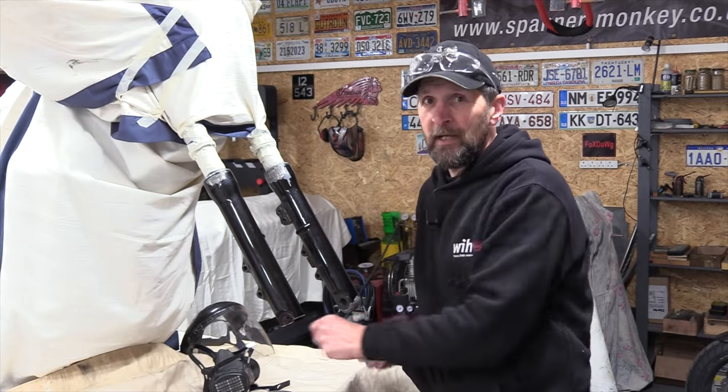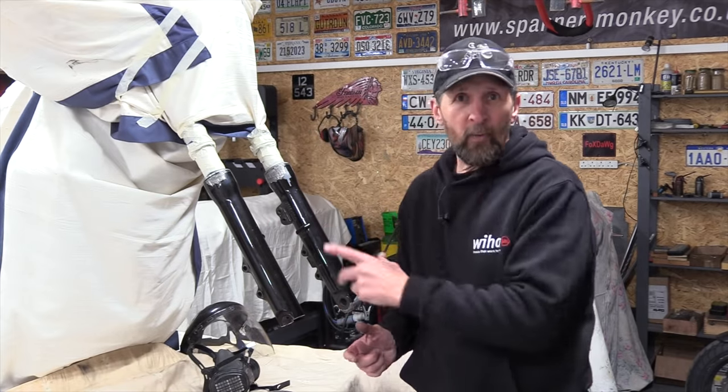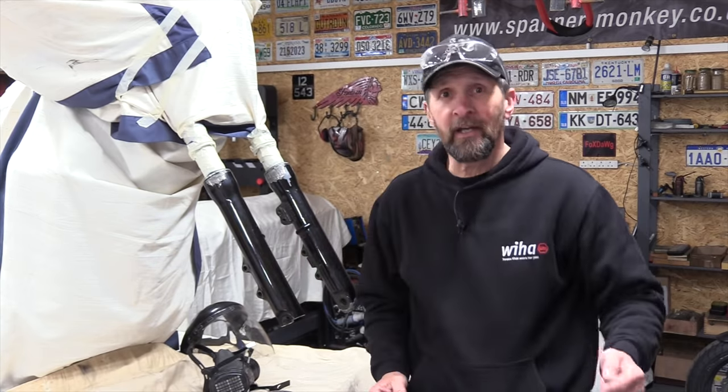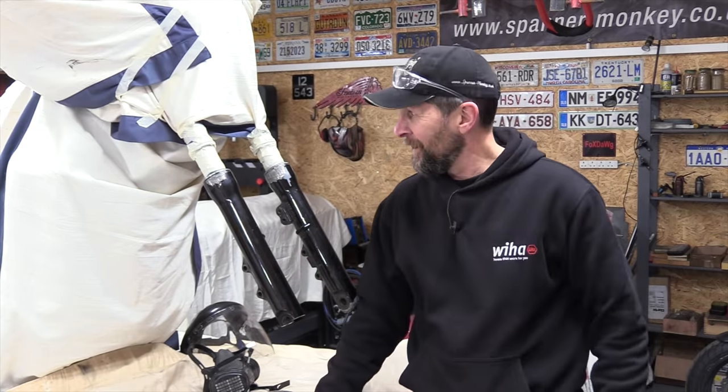So once they're all bare metal, it's just a case of wipe them all down. Three wet coats of stone chip paint, black gloss, just like they are, and then put everything back together in the next video. Put the front back in and then we're done. So let's do it.